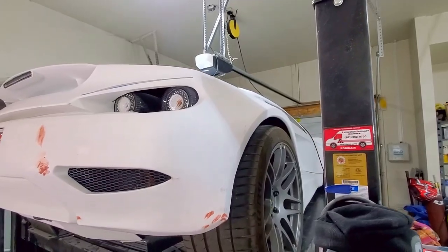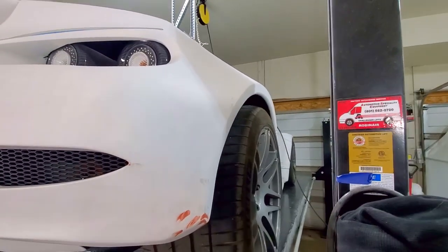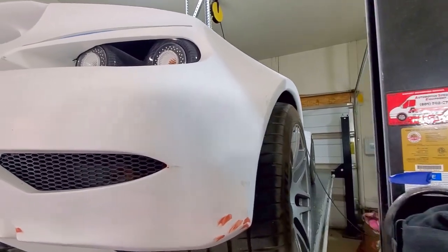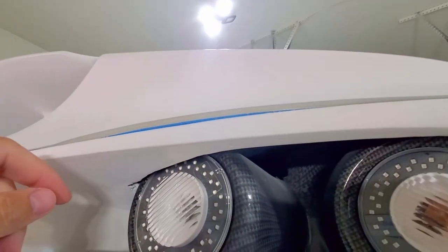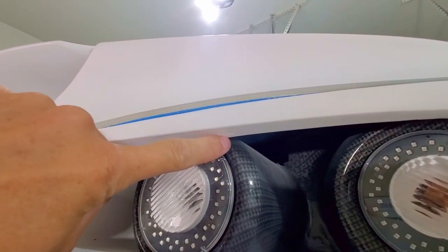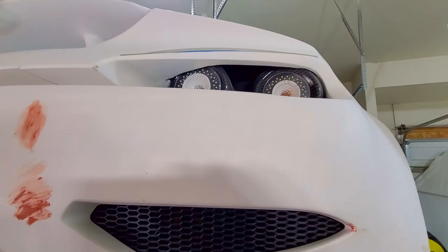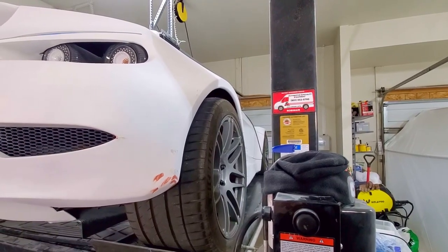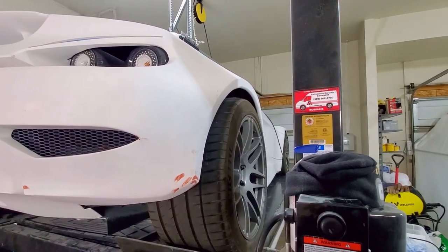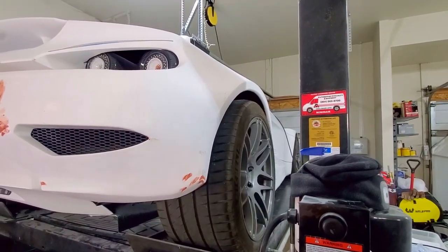I'm entering the touch-up phase. There's tiny, tiny spots, but this is the speak now or forever hold your peace. It's things that you don't see until you look close. I'll get the filler out or the glazing putty and go all around the car, make sure I'm happy with all the panels. Even after I do the primer, I may find one or two more spots. But the intent here is just do a once-over and then call it good and start disassembly.